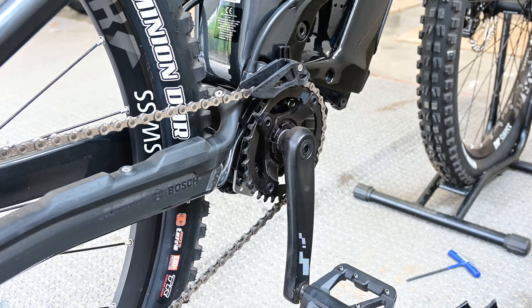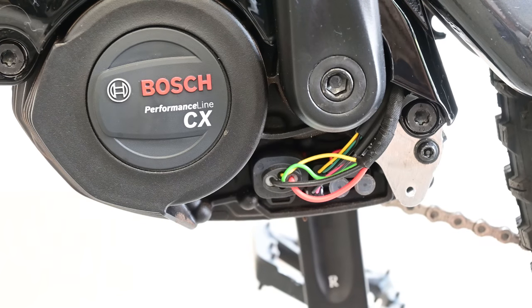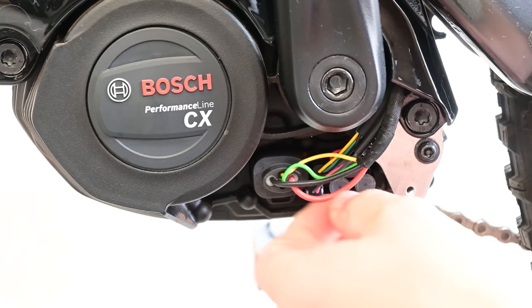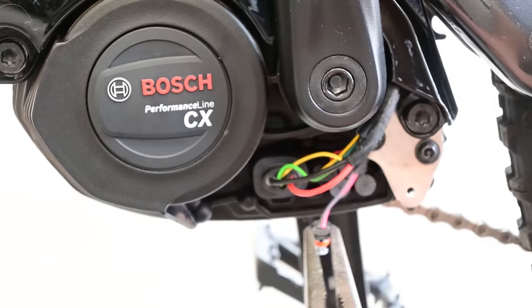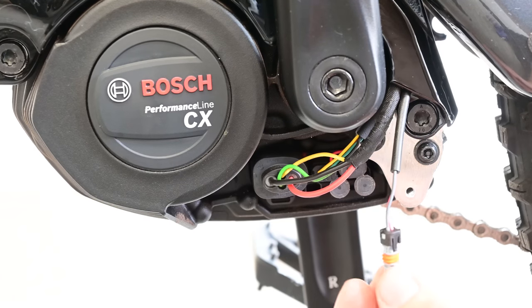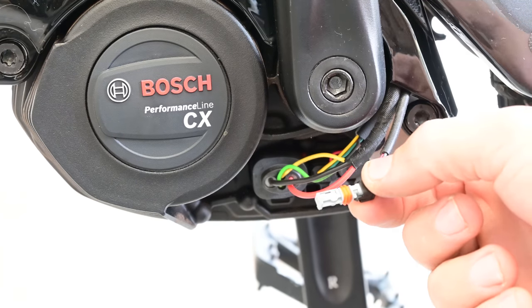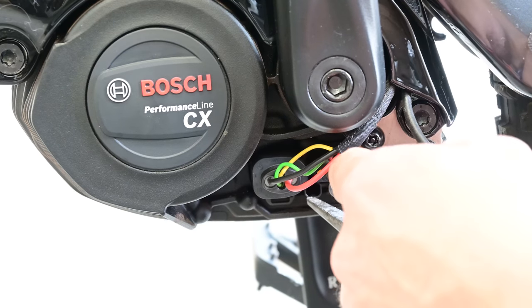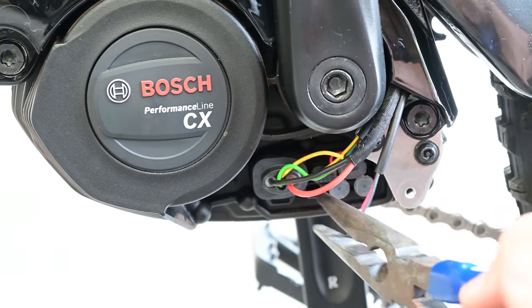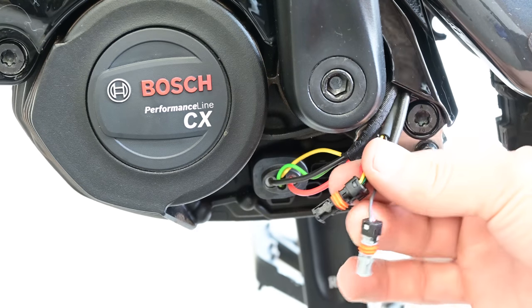Now I've got access to the motor plugs — I'll show you how to install the chip. All we've got to do is move these wires out of the way from the battery plug and unplug the two-pin plug. Gently pull it — it's a grey plug with a red and a black wire. In some motors there's a blue and a black plug as well, but on this motor there's only the grey, so the grey is what you want every time. Then you need to pull out the four-pin connector which is usually above. There we go, they're both removed.